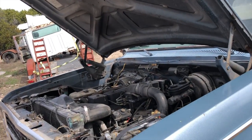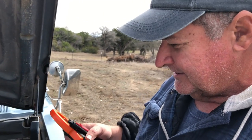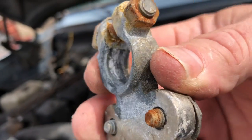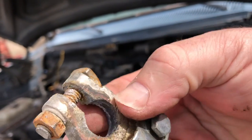Crank it up. Ta-da! Just a little explanation on how you can troubleshoot corrosion like you saw — hopefully you saw — the voltage drop between the two metals that had the corrosion in between them. This terminal, hopefully you can see that crap on the inside there. It's just coated, plated metal. It ain't ever going on anything I own ever again.